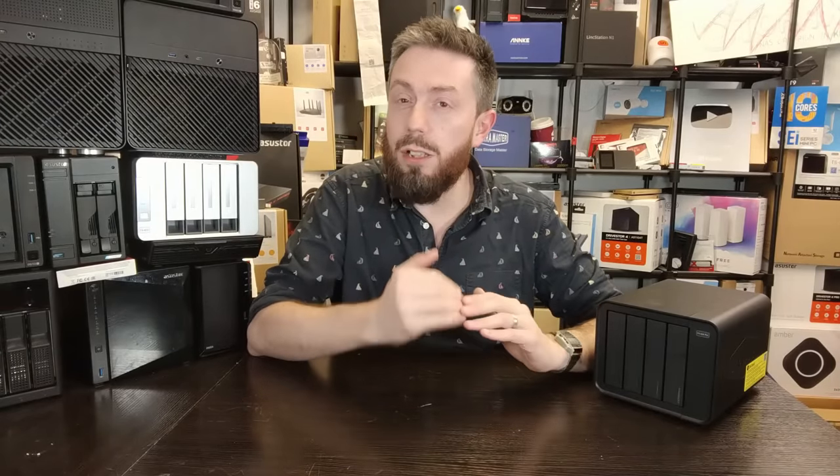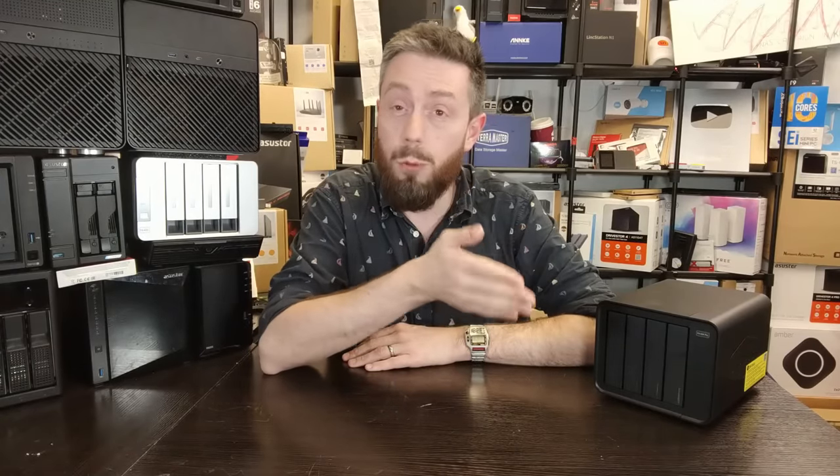The power consumption for a system that will have four hard drives and four NVMes sits at 38 to 40 watts during active use — tested with 24 TB and 22 TB drives by TerraMaster themselves. The system also arrives with an external 72-watt PSU. It's not incredibly small, but it's also not that high once you factor in the scale of the system.